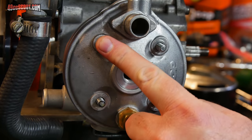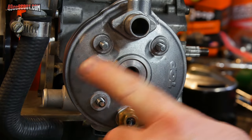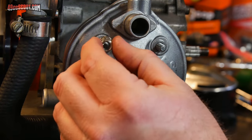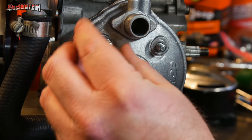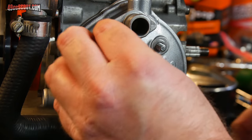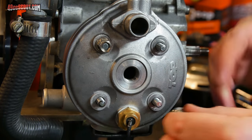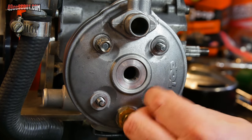The cylinder studs have been cleaned, so there should be no residual oil, no grease from the O-rings, no gasket sealant, no nothing on there. The nuts have also been cleaned, so again, there shouldn't be anything left over from the last time they were together with oil in the threads.